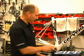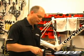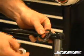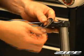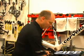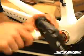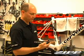Now that we have the bearing cups installed in the frame, it's time to install the left arm. You want to get out your shim pack, and in that shim pack there's 2 of these aluminum spacers, 3 steel shims, and 1 wave spring. For this part, you just need 1 of the aluminum shims. Apply the grease directly to the spindle. Make sure you have a good thin film on the entire spindle prior to putting it in through the bearings.